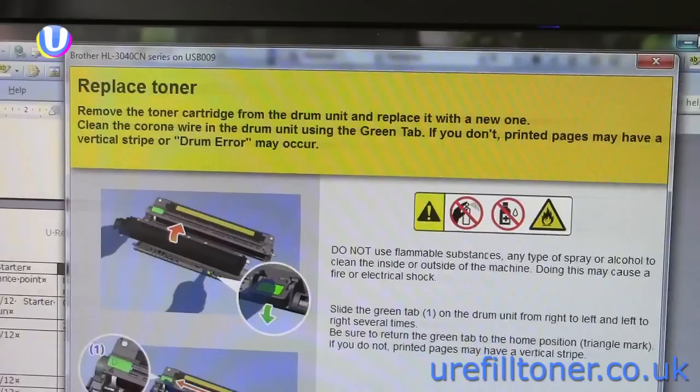When the machine stops printing and you get this message, it's important to realise that the cartridge isn't actually empty. There's still about 15 grams of residual toner left in there. You have to be sure that the refill toner you're going to put in is capable of refilling on top of the residual without causing any print defects — and U Refill Toner have consciously checked this.